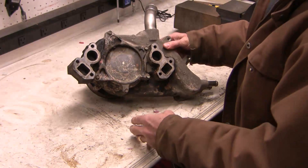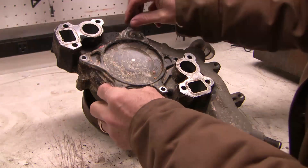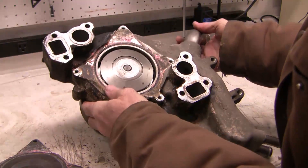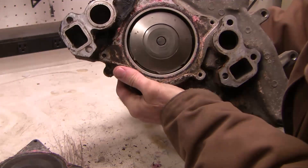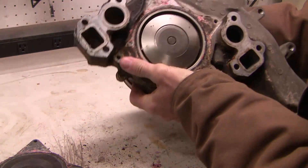So let's take these bolts off and have a look. I'm not seeing a nut or bolt on this end — you can see it spins like so. I'm going to take a three-jaw puller and see if I can get this part off and disassemble this a little further.